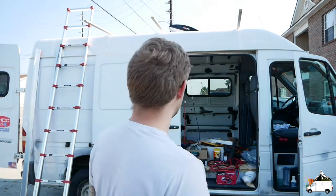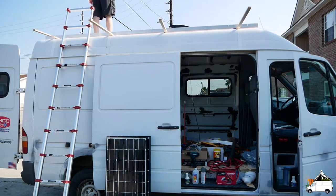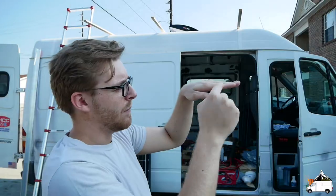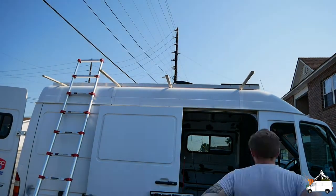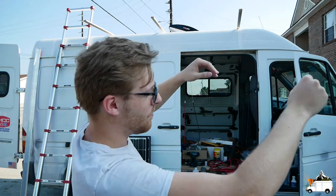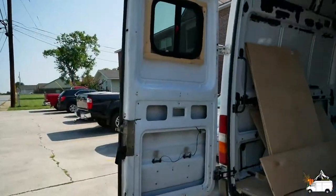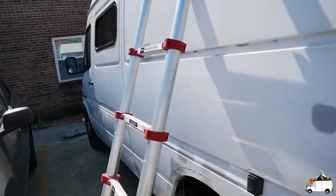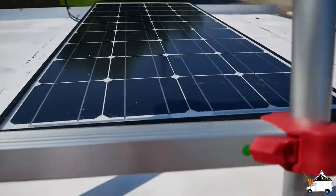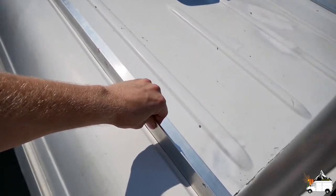The way I'm doing this: I've got three furring strips up here and I'm going to put the angle iron on top of them on both sides, holding it up off the van roof. Then I'll put in the two solar panels to hold the angle iron at the right width distance from each other. Since the furring strips are lifting it, I'll be able to start peeling the film off the tape and move the furring strips back to push it down in place. The rack is officially mounted — and honestly this stuff is so strong I can't even move it.